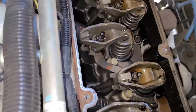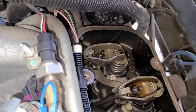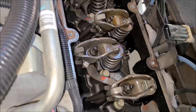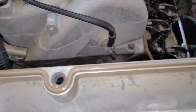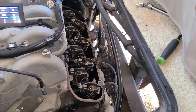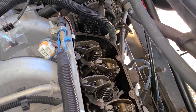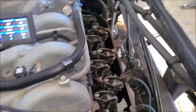I am very pleased. Looks good. So now you know if you need to check an engine out, it doesn't take much — just a few minutes to pull the valve cover. And because of this large rubber O-ring, you can just reuse it without any issues. You may not know this, but the 8.1 will actually run on just one bank. So with all the coils disconnected, I'm going to start this up and show you what it looks like.